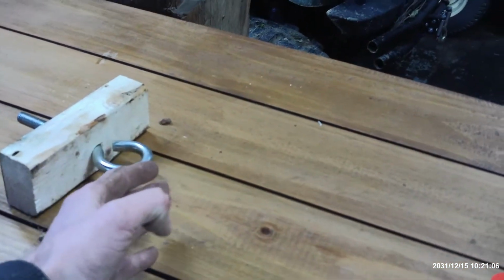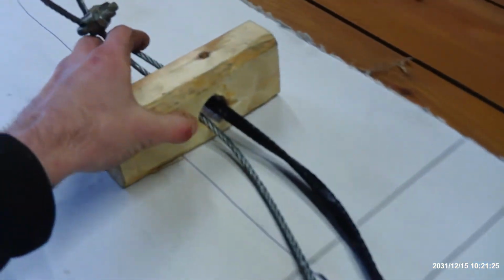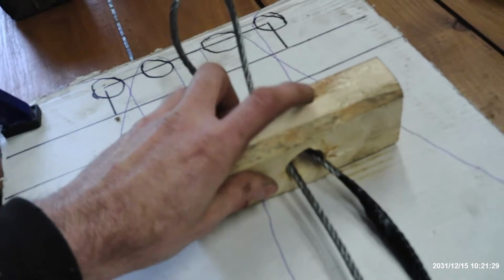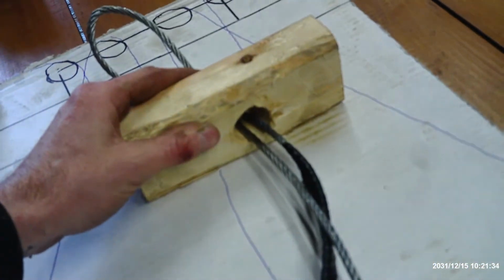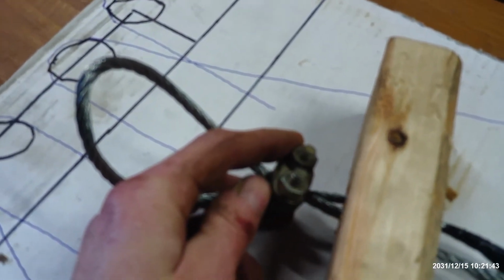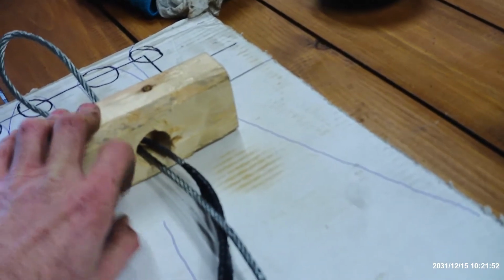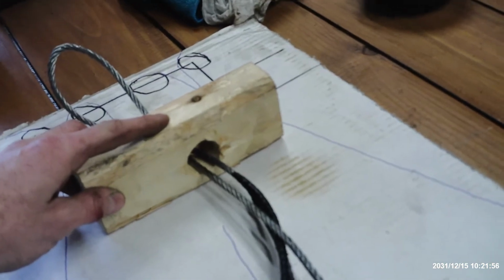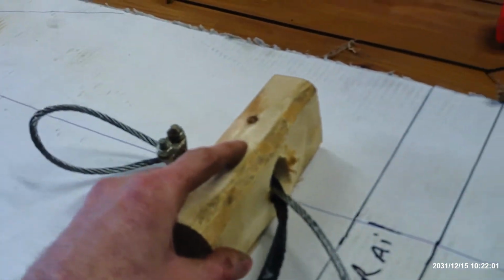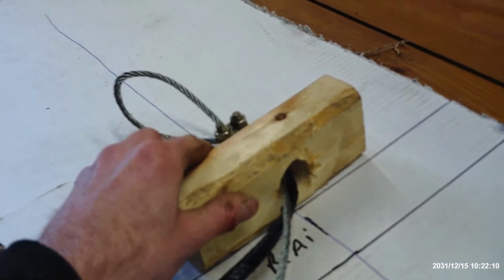and make it so nothing stuck out of the front of the splitter block, like it was factory. It was factory just on that worm gear and screw, so it had nothing sticking out. So I took my wire, hold on, I'm tangled, and excuse the cable, but I pulled my cable through the hole. That hole was absurdly big because I didn't want to put a kink in my wire, but simply pulled the wire through, put a big 1/2 inch grade 8 flat washer on the back, and then put a cable clamp on it so it couldn't pull through. That left nothing sticking out except the wire that actually pulled the assembly. Once that was resolved, it could make the full 20 inch pull with nothing sticking out. The wire went straight into the hole and the splitter block pulls right up tight to the frame. So it worked out very well.